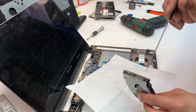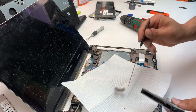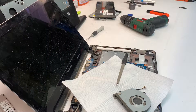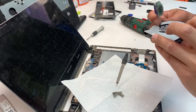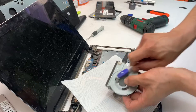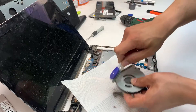Simply remove all the dust and debris and whatever other stuff that blocks the fan. I have made this DIY toothbrush that I use to clean up the fan. If you've got a toothbrush that you don't use, simply use that to clean up the fan. Because you can't really open this fan unless you want to replace it. Just get around under there, brush it off, and hold one side of the fan while you brush the other side.